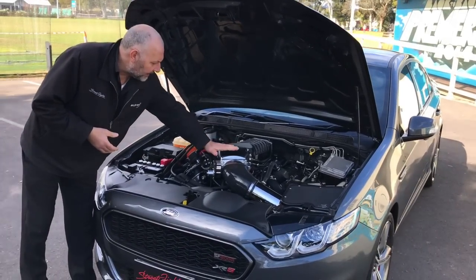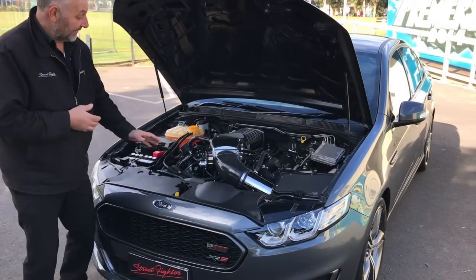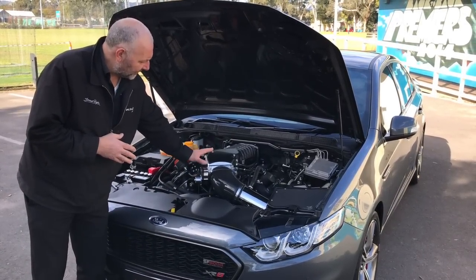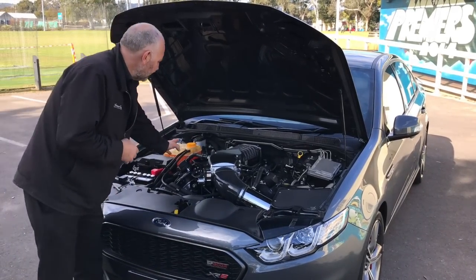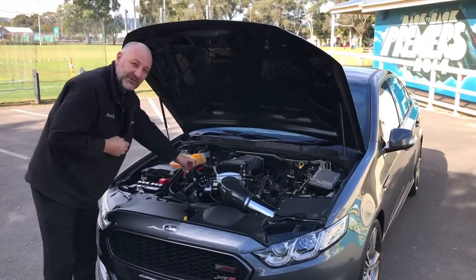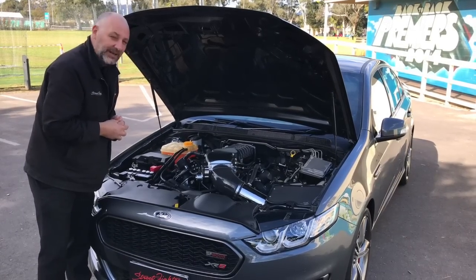We've got a large twin 65mm throttle body here. Now that's an option that we've given the customer on this one. We've got a smaller twin 60, but we've designed it to utilise the twin 65. We've got the StreetFighter breathers, oil separator breathers. They'll catch the oil that bypasses through the engine, catch it, and just keep the intercooler system all clean and tidy.